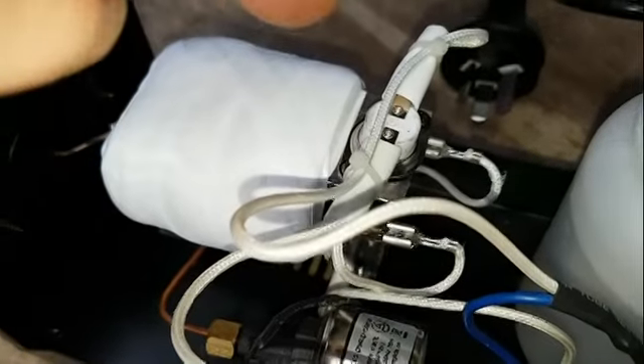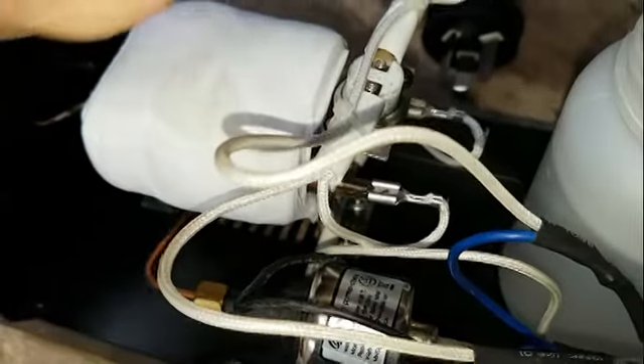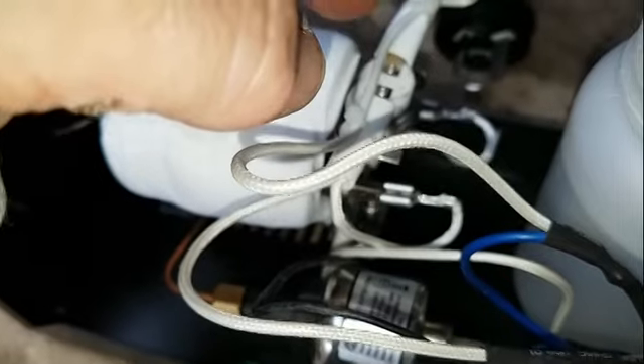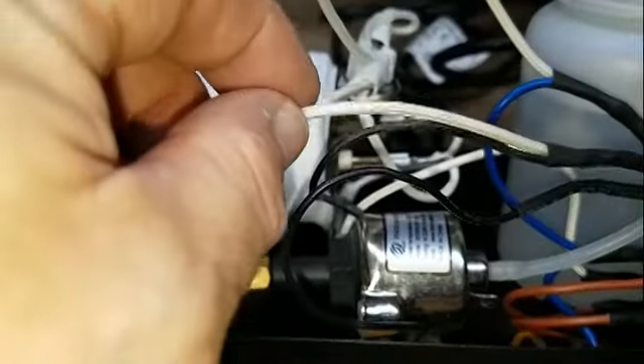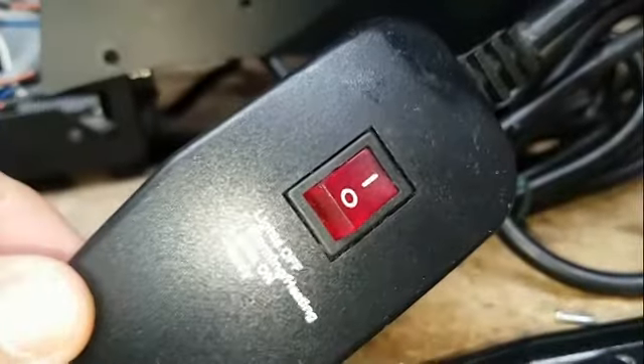When it's cooled, that thermostat makes a short to the actual neutral coming in. So when it heats up, it disconnects the power to the element, which then powers the pump once you have the switch turned on.